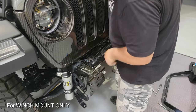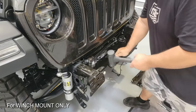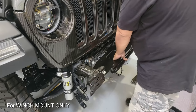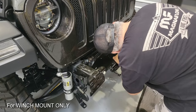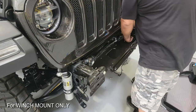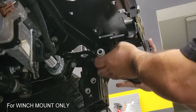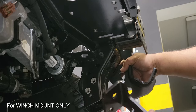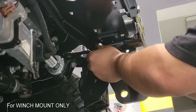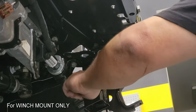The easiest way to make room for this is to use a ball-peen hammer or a small sledge. There's a standoff where the mounting happens, and all we're trying to do is work it down that small amount to get those two braces in there along with the winch mount plate. Using the dead blow hammer and working it down at an angle will get the bracket in place without doing any more adjusting to those standoffs on either side. Now we can put those bolts in by hand and focus on installing the winch support brackets with the rivnuts we've just installed from the bottom. We're going to place those winch support brackets on the bottom in the newly installed rivnuts, then put bolts on and take them right off in the next step because there are a ton of options — leave everything loose.